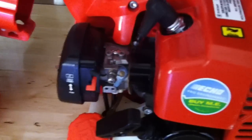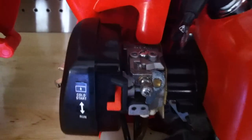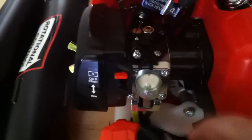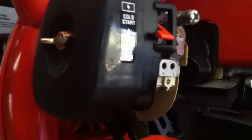I want to go over the differences I can notice visually about these two identical model numbers. The first one — the older version — I bought this in 2010. It's got a Walbro carburetor with the primer bulb at the bottom. On the new one, it's got a totally different carburetor with the primer bulb on the front, a totally different throttle connection and throttle mechanism. The fuel lines on the old one are right here in the front, and the fuel lines on the new one are in the back — so the orientation of the carburetor is definitely different.